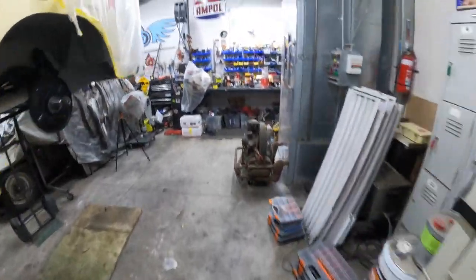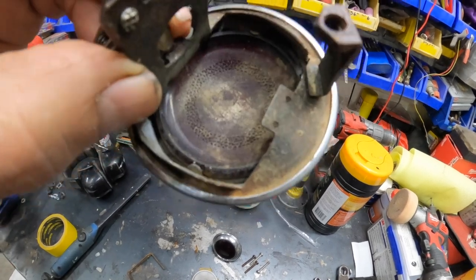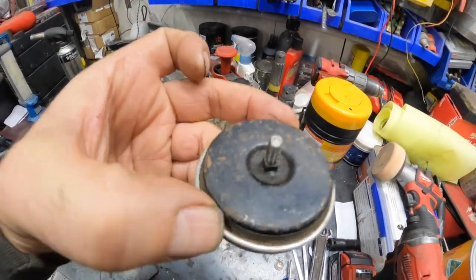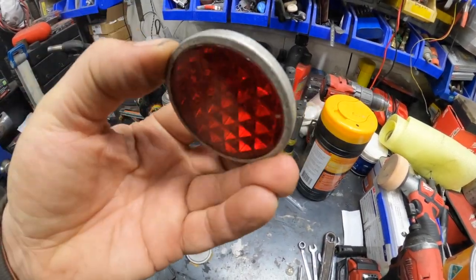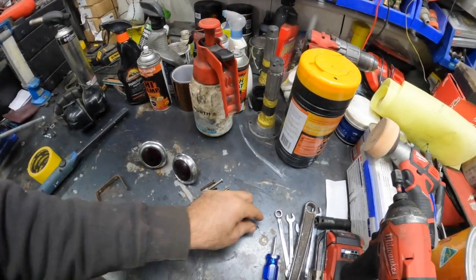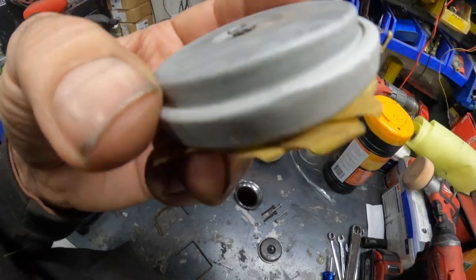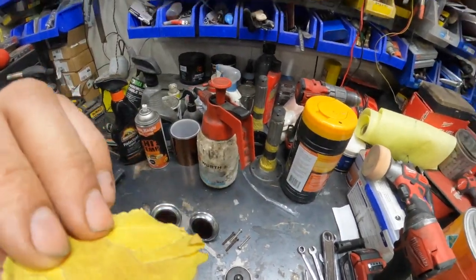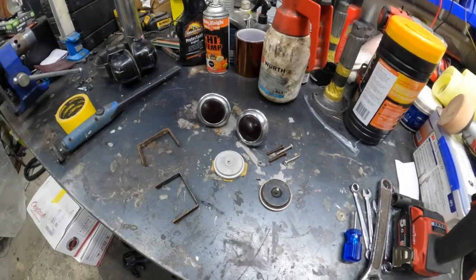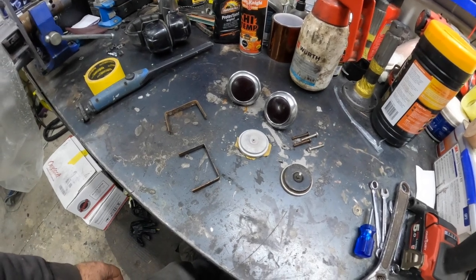With the lights, we're going to do a little bit of restoration work on these brake lights because they're pretty shonky. I've got to be very careful because these things are very hard to get. This one here is supposed to have a bolt on the end of it — this one's pretty nice but we're going to make these look better. Unfortunately this one has been snapped off and some muppet has gone and put a self-tapper straight into the back of it. I'm not going to let that fly. I'm thinking of just putting a little tack weld and then a quick bit of cold air — it shouldn't put enough heat in to do any damage. We're just going to weld a thread back on that.